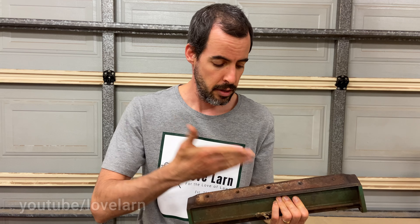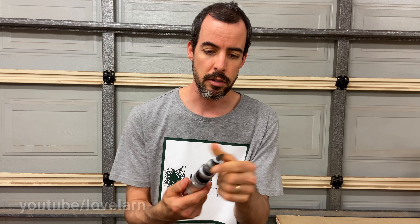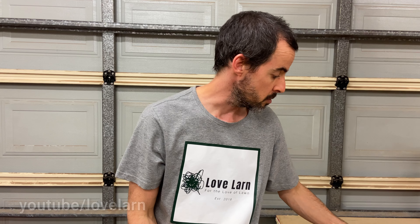Try it and see. If you're lucky they'll come out. If not, there are other means — one of which is an impact driver. So that's a manual impact driver with a flat-bladed driver on there. Pop it in there, give it a whack with the mallet or whatever, and it delivers that impact to get those screws moving. If that doesn't work, you can try a little pin punch and tap the thing around to start it moving.